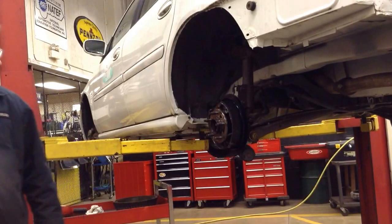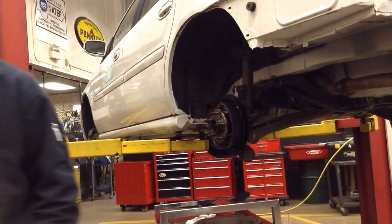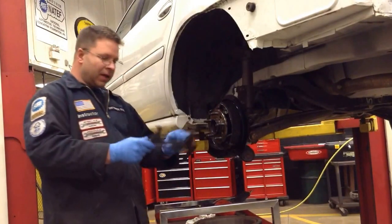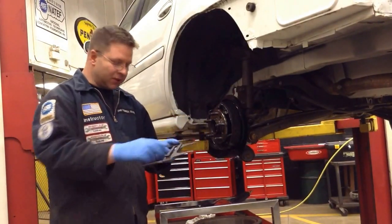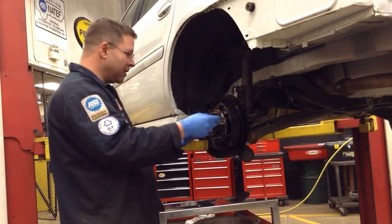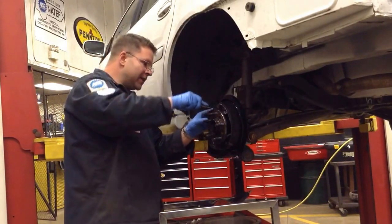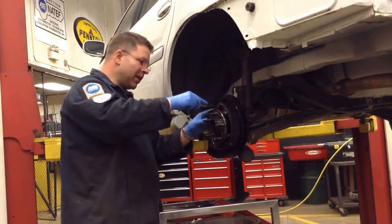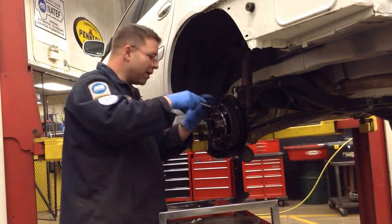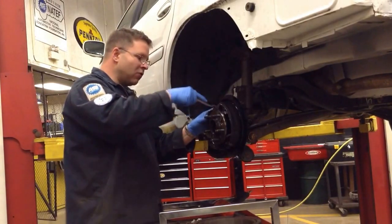We're done with our parts washing sink, and the next thing we'll do is bring my cart back over here. I'm going to get these ready for adjustment. I'll take my caliper, take those two teeth out, and insert them into the brake drum after loosening the lock screw. I've made contact with the drum. Now I can go ahead and slip this end over the brake shoes — that gives me an idea of how much adjustment I'm going to need before those shoes are contacting the drum. You can see the star wheel adjuster in there; that's why I've got my brake spoon. I'll go ahead and adjust that up so my brake shoes are lightly contacting the drum. You definitely don't want to over-adjust here. Turning that star wheel is forcing the brake shoes out a little bit.